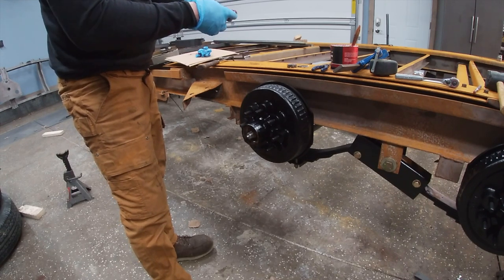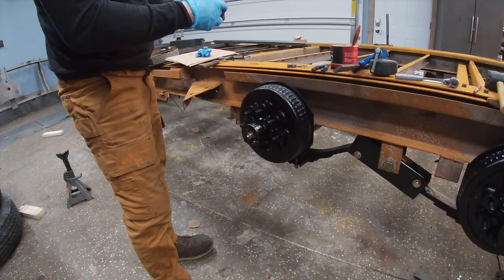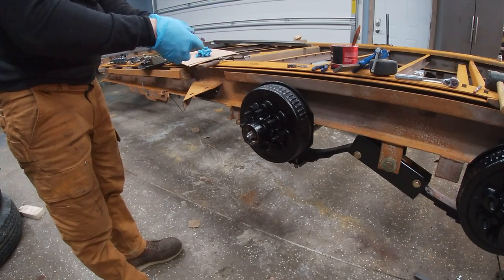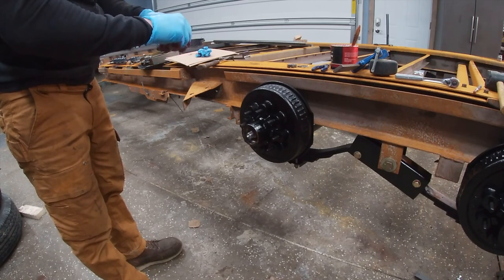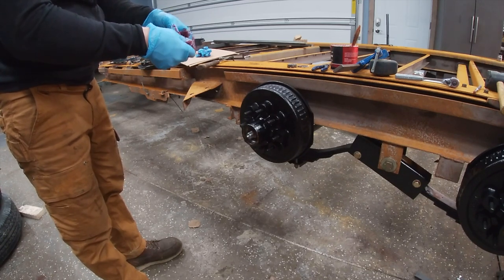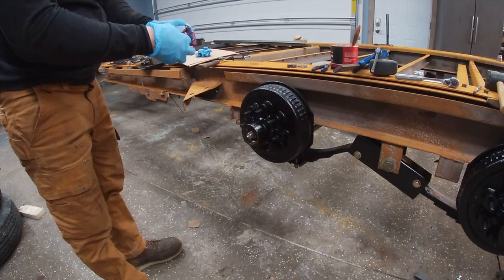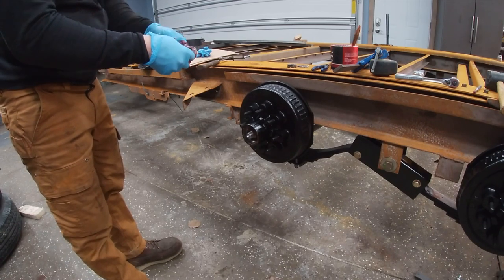in order to keep the wheels from falling off on your trailer, this is best practice. So, the wheel bearings that I took off this trailer weren't terrible, but if I'm in here, I might as well replace the bearings. Obviously, the previous owner overweighted this trailer, and I just didn't trust those bearings in the condition that they were used in, so we grabbed a new set of nice Timken bearings.